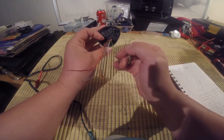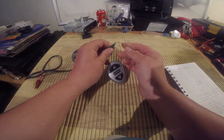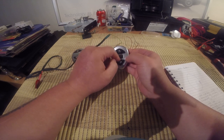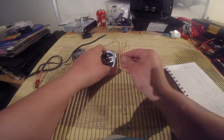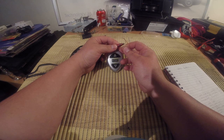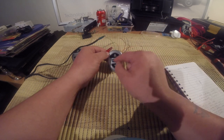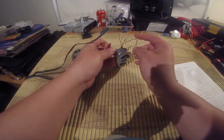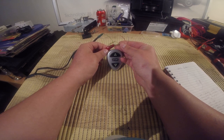This wire here, which is pin five, is the earth terminal. So I've got my trusted power lead here and I'm going to attach that to that one. To make the lights work we want pin one, which is this white one — if I hold it there you can see it switching on and off, the actual light lights up. There's also another light which illuminates the sports button, and that is pin number two, which is this brown wire. You can see that one — it's quite bright. Yes, that one works.